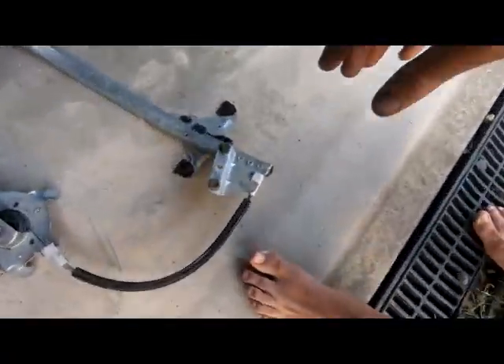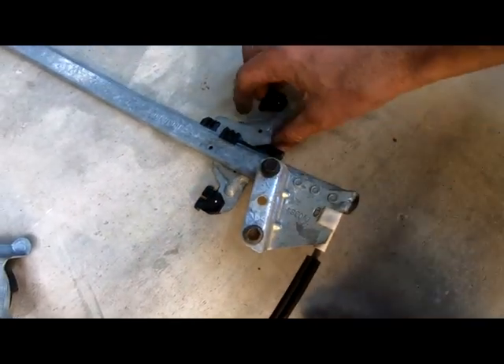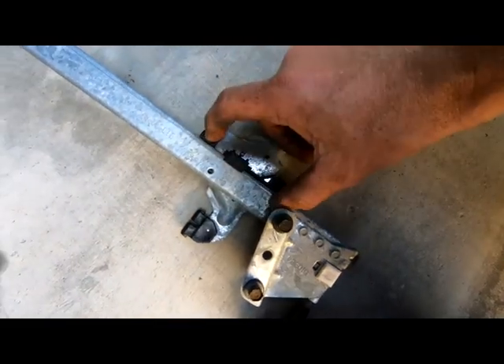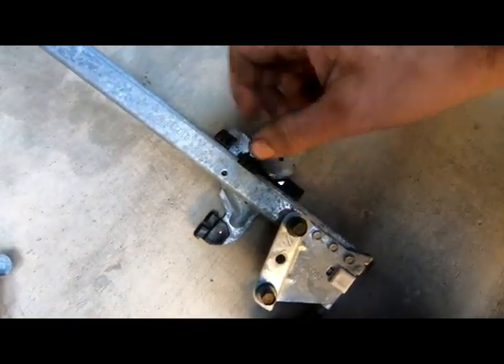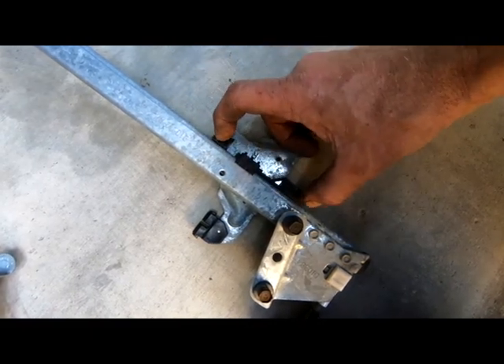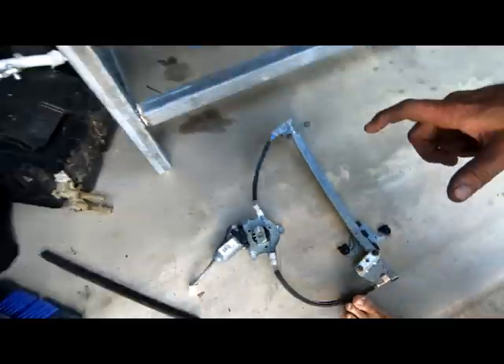So we put the new window mechanism in - it functions correctly again, still has a little bit of play like the last one. The problem with these things is in the main up-and-down section there are plastic sliders, and the sideways motion is where our issue stems from - it's doing this wobble at opposite ends. So what we're going to look at is getting this one and trying to put a slider in these two plastic bits to make up that slack, then do a full swap out, test it out of the car, and see if it makes a difference.